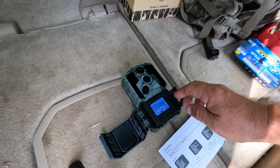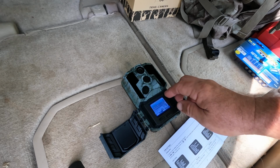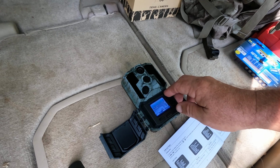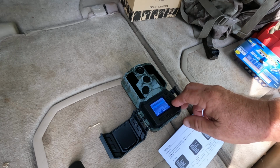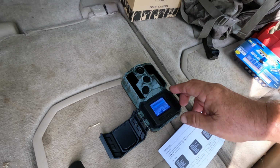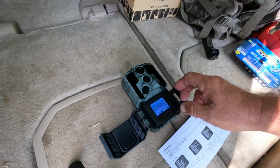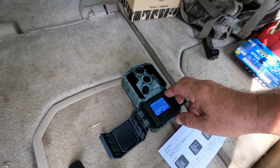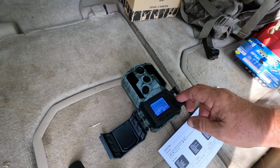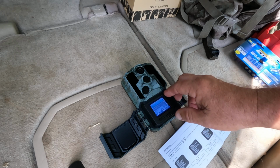We got time and date, language. Make sure, I'm sure it's on English. Yes, it's on English. Come back. There's also a Dutch setting. I do not want time lapse. All right, target recording time. I don't know if I want to do video. I'm going to do both. So I'm going to go up, let's see, sensor level. All right, it's on the middle. I'm going to leave it on the middle set, and it's low, middle, and high. Side motion sensors. Okay, they're on. Hit the menu button to go back.